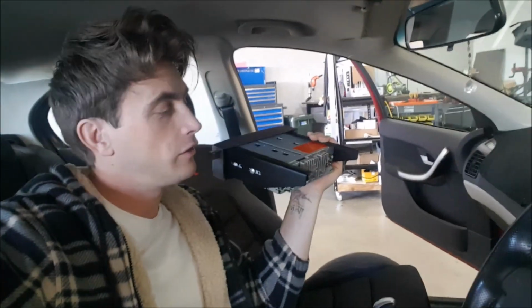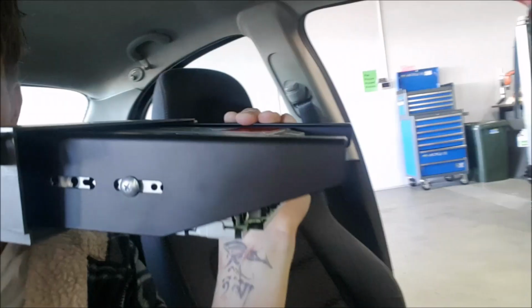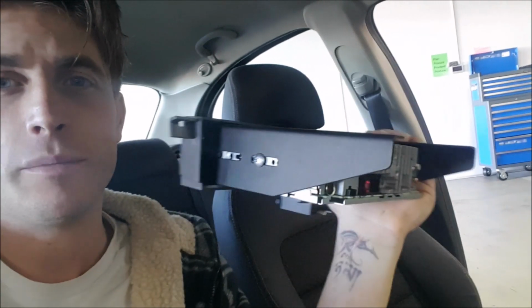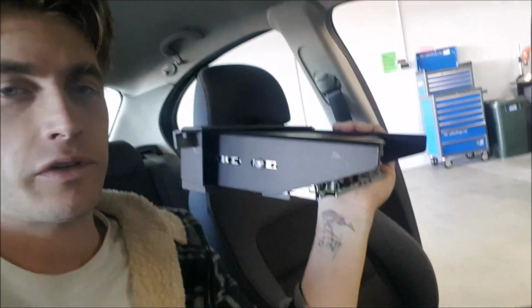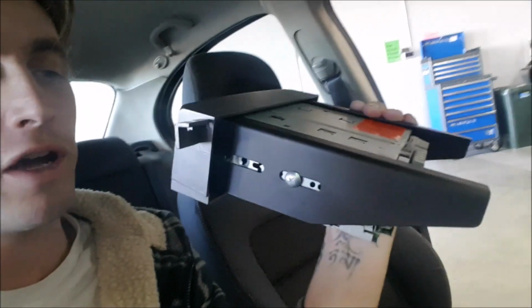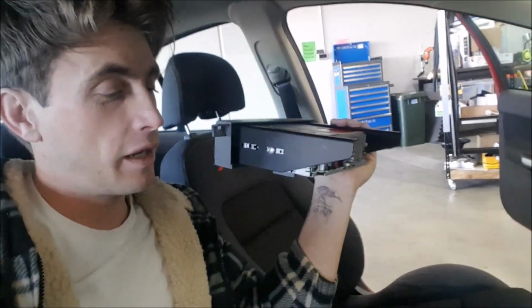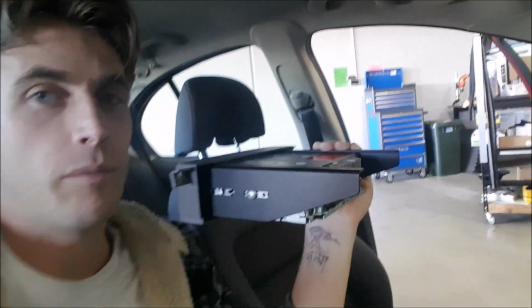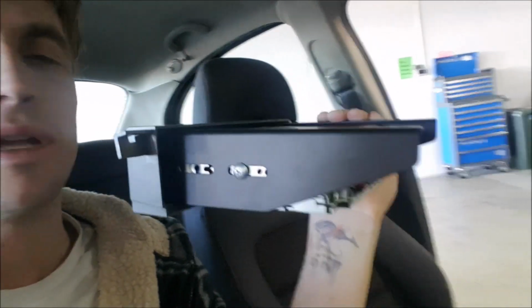There are some circumstances on some models of these cars where the black bracket here is actually about 2 centimeters too long. Not on everyone, but just the odd model, there's a couple of different airbox shapes back there. So if you find that when you go to refit it and it doesn't quite duck in all the way, double check all your cables, make sure none of them are getting in the way of the fitment. But if all of the cables seem clear and it's sitting well, then you might need to shorten these steel brackets by about 2.5 centimeters. Just chop them off with a hacksaw.